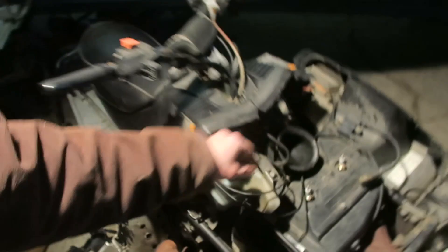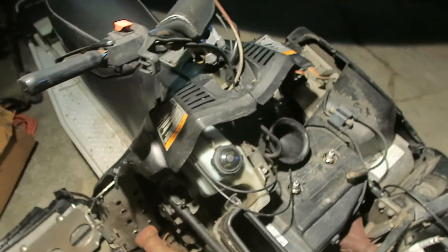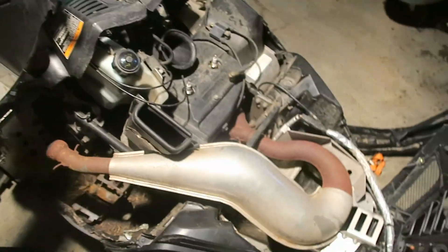That really sucks, but at least the sled is still here in one piece — or multiple pieces, but at least it's still here and still running as far as I know. The plugs look good, I tightened them up. Doesn't look like it was running too lean — no white spots on the plugs, so that's good. We just gotta do something about that. Still gonna clean the carbs; oil is good, gas is good. Might as well buy a new cap for the tank.